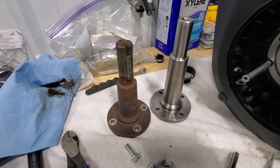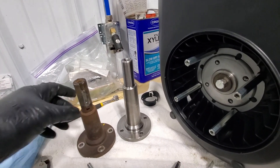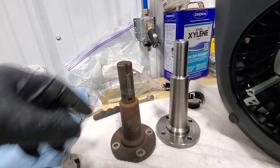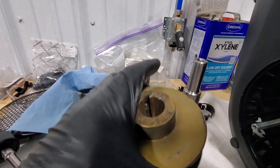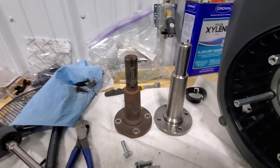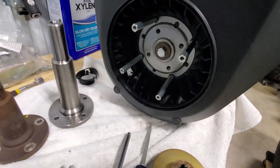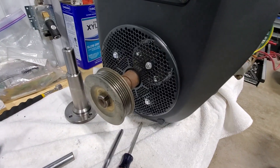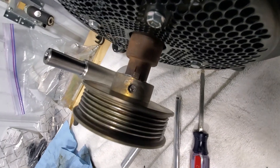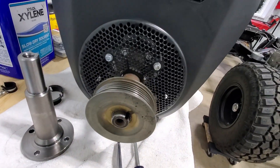There's the piece off the original motor — you can see the difference in length. There's not enough clearance on the John Deere machine to run the longer one even if you wanted to. You can see the mark where the set screw goes for the pulley. The pulley came off relatively easily — I just tapped it with a rubber mallet. I'm going to go ahead and bolt this on, get the screen back in place, and then put the pulley in place. The adapter is on and the pulley is back in place, aligned to the set screw mark.